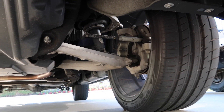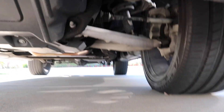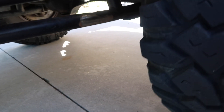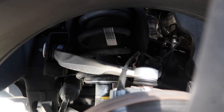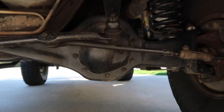If I come over here, there's a 2016 Chevy Tahoe with the A-arm setup. You have a lower arm and then up there you have an upper control arm — you can kind of see it through here — and the shock just goes right down the middle. On this you have the coil right here, and then you have the Bilsteins which connect down onto the radius arm, which is a lot different. You have your lower and upper arm and the shock just goes right through the middle.